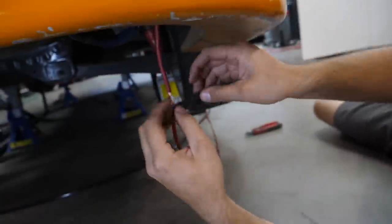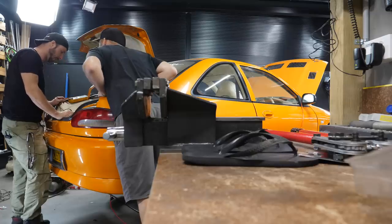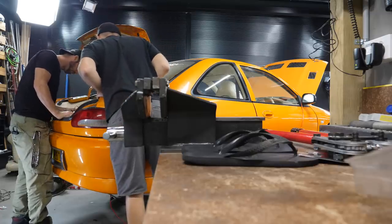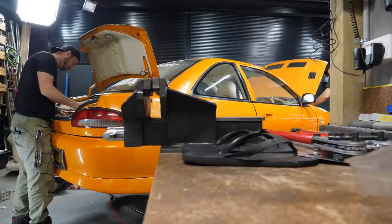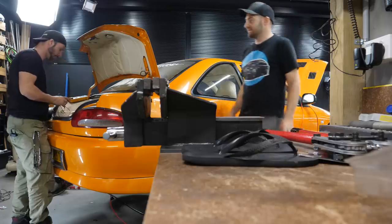I'm going to recycle some of the old tape. There you go, it's still auto salon spec. Let's just test that we've got power before we do the head unit business. So if you stick the negative terminal back on, it's going to go kabam. 3, 2, 1. Yep. Boom. Yep, 13 volts. Dude, good to go. Healthy battery too.